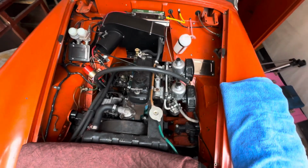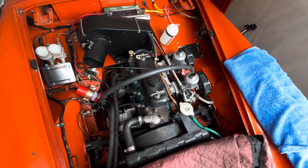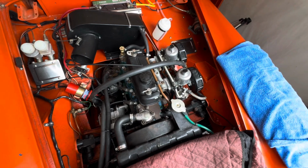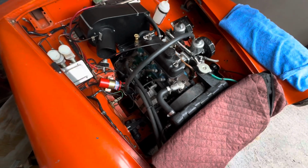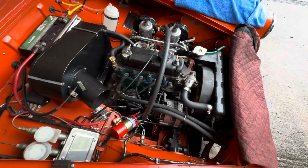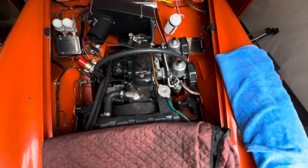and what that's hopefully going to do is create a vacuum which sucks the oil back into the engine rather than there being no vacuum and the oil managing to find routes out of the sump or wherever it's coming from, because we didn't actually quite figure out where that oil leak has started. So that's going to happen in the next video.